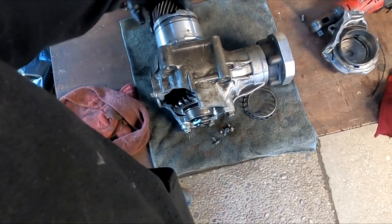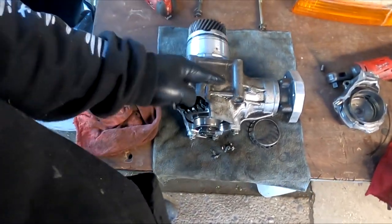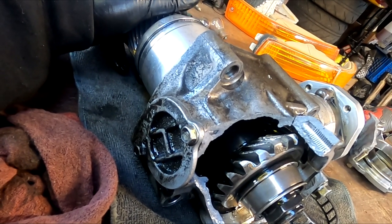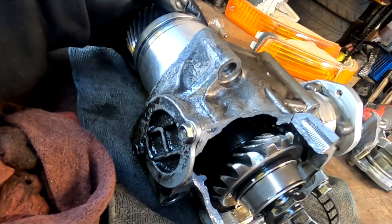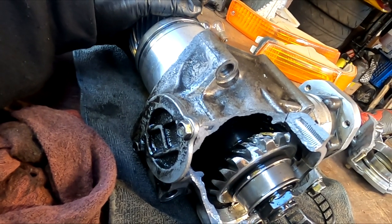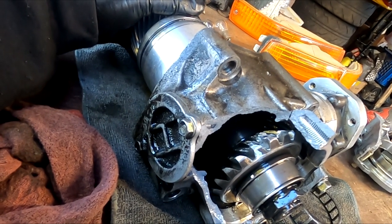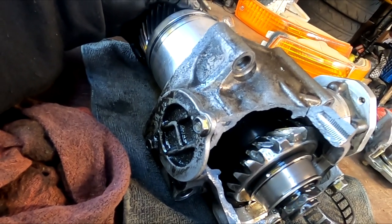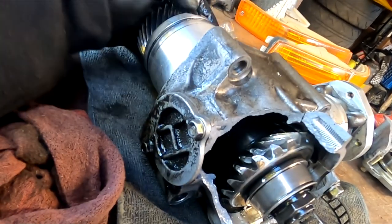Every time Joaquin broke his, he'd be snapping the shaft and his whole transfer case would fall out of his transmission. Normally I hold the e-brake up, load it up, get the car to roll a little bit and let it bite. But when I was out there that night I was a little skeptical and just went for it — did not do my launch how I normally do it, and it pretty much just went kaboom.